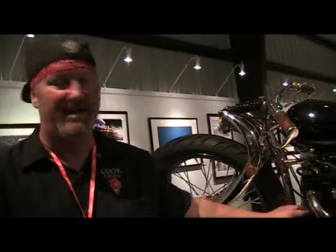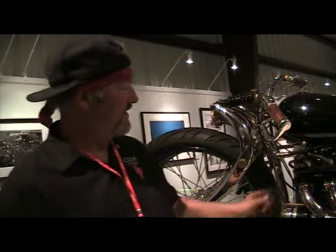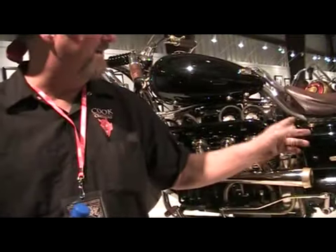Since the charging system is inside the transmission on this motor, I had to make a front bell housing with the chain. The other side of the bell housing has the oil pump, and all these lines on the outside are all oil lines. I love the shifter look on the other side, so I took the guts out of it and put a four-speed tranny inside of it, which was a lot of machining.